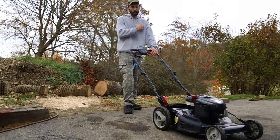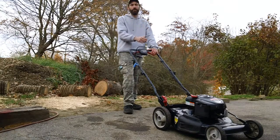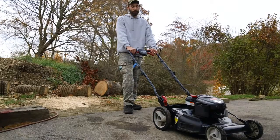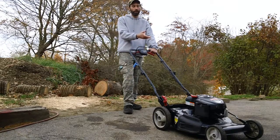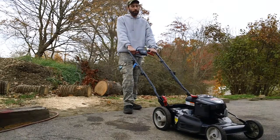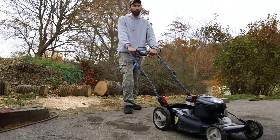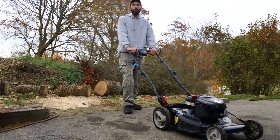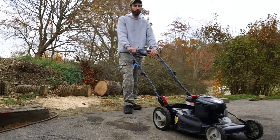So if you've got a newer machine like a 2010 up to 2013, be aware of that. If your machine has an auto choke, it will have a wind vane on top of the carburetor that's actuated by a spring and also by the thermostat mechanism on the exhaust side. Those can give you quite a bit of problems if you don't know exactly what you're looking for.